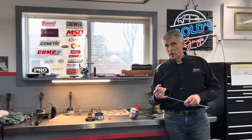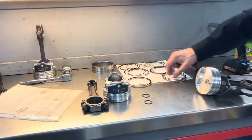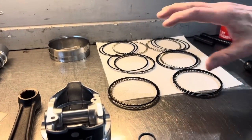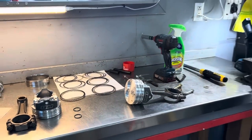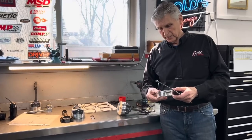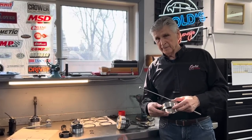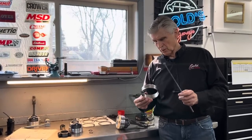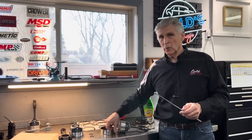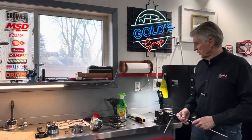The second ring is marked 'top' and 'bottom' — always pay attention to that. 'Top' doesn't mean it's the top ring; it means that side of the second ring faces up. The other rings are already laid out — I've already put two pistons in, so I'm down to four sets of rings, and you keep track of everything as you go. For this engine I don't have a custom ring compressor — I use this universal one, which works pretty well on lots of different sizes. This is a 4.080 bore, which is an odd size, so the universal compressor is the right choice here.